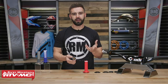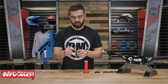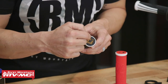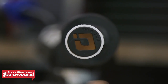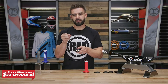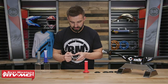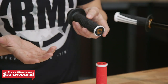I just like everything they've done to improve the overall feel. Now, talking about durability — that's another thing I love about lock-on grips, I think they're just more durable. When you look at the end of this grip, you'll notice you've got this hard plastic piece on the very outside. But what's new with the Emig Pro is that they're now using an aluminum end cap versus just plastic. Underneath this black plastic piece, you can see that aluminum there — it's got that bronze color, something that ODI does really well with a lot of cool colorways. That aluminum end cap is actually molded to the plastic sleeve, and it actually goes over the handlebar just a few millimeters. That means if you have a crash or even just a tip over, you're much less likely to damage the grip or tear the rubber, because the rubber comes to the very end but ends where it comes up — no rubber on the very outside to worry about tearing when your bike falls over.